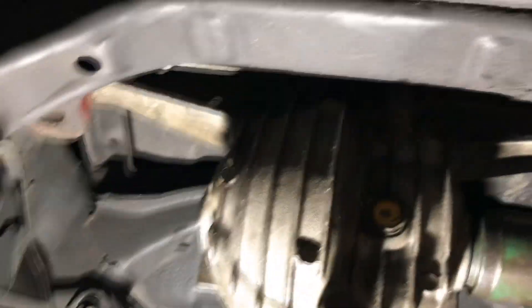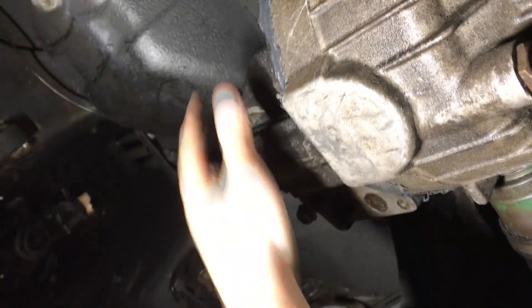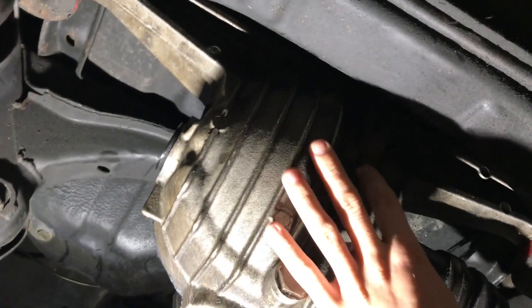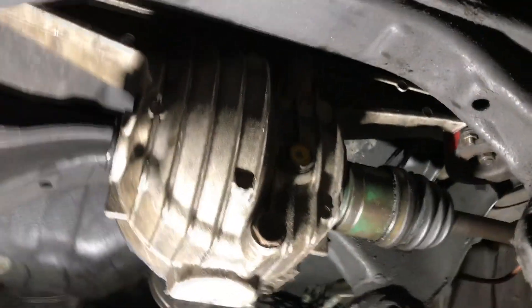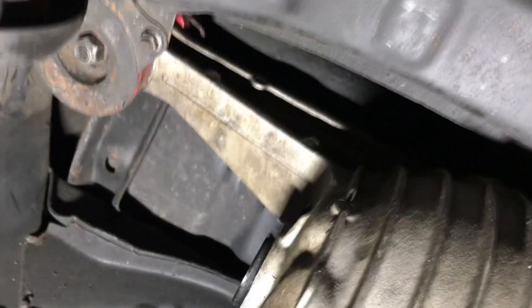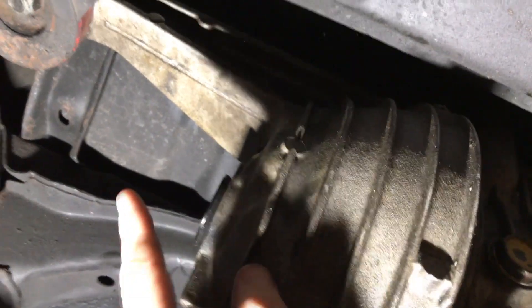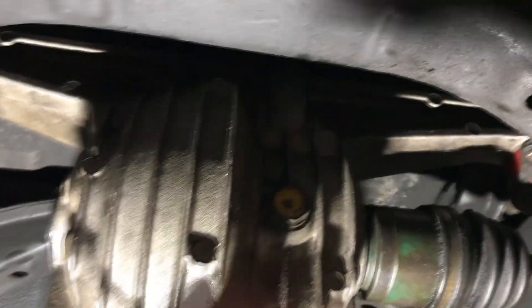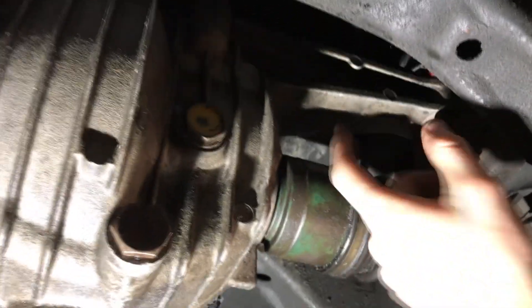The diff is in. The actual diff part — the full diff internals — is from the Miata. This is the LSD Miata diff. The gears were fine; I inspected it and everything looked good. Nothing was broken inside. All I did was swap the actual housing pumpkin case. The RX-7 NA diff housing bolts right up — directly. It was the exact same dimensions, perfectly — all the bolts were identical. I had to swap the bushings, which was not hard at all. The aftermarket polyurethane ones from the Miata came right out. The OEM RX-7 diff bushings I had to cut and drill out. As I said in the last video, this diff is way stronger — it's thicker and does not have that little notch that breaks.